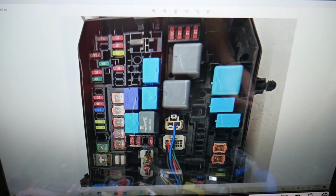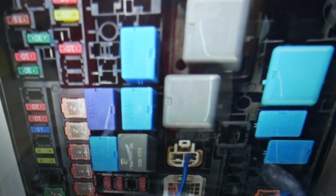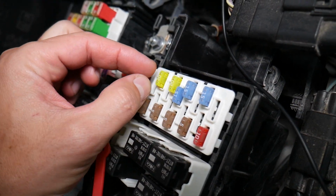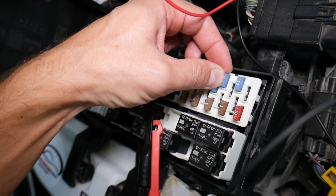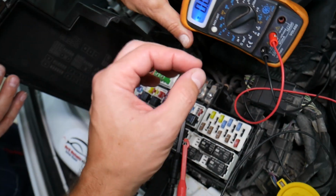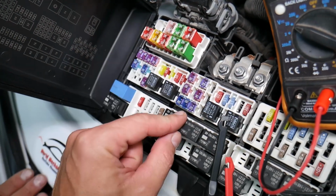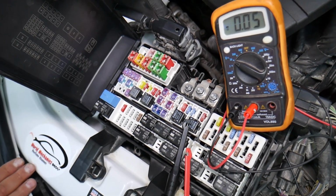Before we continue, let's explain quickly why it's always a good idea to test fuses and relays. Let me explain why it's super important to test fuses. Not often can you see if they're burnt or they're good. Sometimes they may seem perfectly fine, you think it's a good fuse, you put it back in and you end up spending money and time on parts and problems that do not exist, when all you had to do was test your fuse, find out it's bad, replace it, fix your problem. So we will have a video on how to test a fuse, different kinds of fuses, and how to test relays. We're going to put the link in the description of the video below specifically to that video.